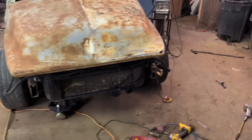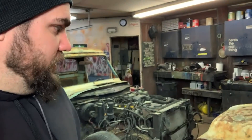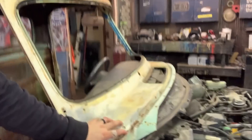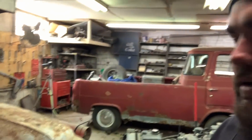Since I'm going to start on the front end, what I'm going to do is get the fenders on the hood — actually just tack weld them to it so I know my gaps are all good. Then I'll try and move this whole thing over to the chassis and start fitting stuff up. The last thing you want to do is mount a fender and then try and make your hood fit. Also, since I'm going to have to stretch this cowl section, I'm going to cut along here and take the edge of this cowl and put it on the hood and tack weld it. That way I know all my gaps are going to be perfect. So even though I am cutting up the cab in a bunch of different ways, everything will still have a factory fit. I just want it tacked for now — nothing crazy — and once I get everything mounted I can go back and cut those welds off.